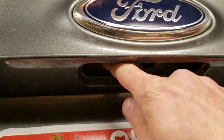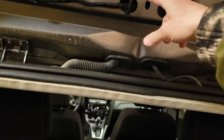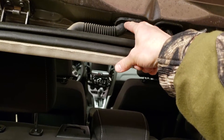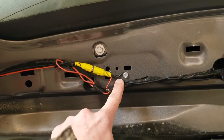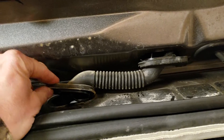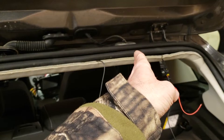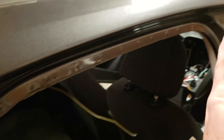Basically all I have to do now is go through this hole here — just drill a small hole and use a grommet to pass the camera wire through. Then I'll run the wire down and around. The hard part is going to be getting it from here down through this area — that's going to be the really challenging part. Once we get the wire fed through there, we can run it down the side and up the side of the vehicle to the front. So I drilled a hole, got the wire run through, comes down and around here, makes a connection here, ran a ground wire here, and then snaked it through with a clothes hanger. I'm going to try to run it under the headliner at an angle towards the front pillar of the car.